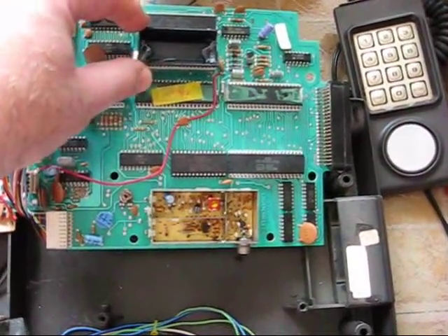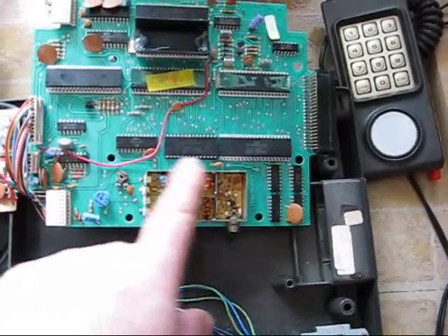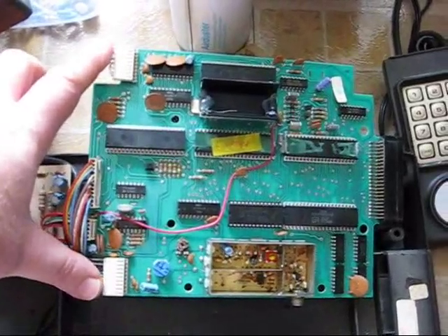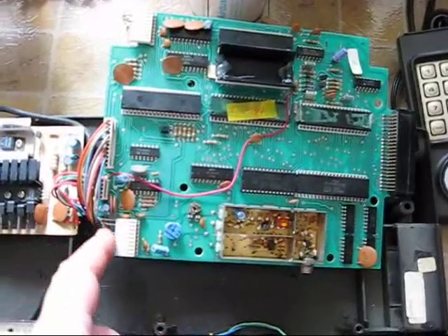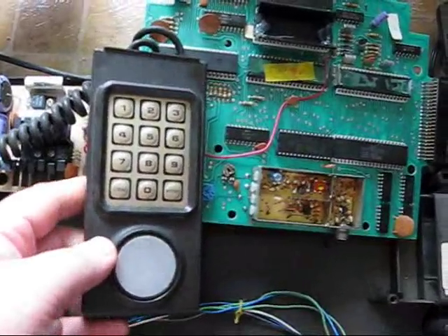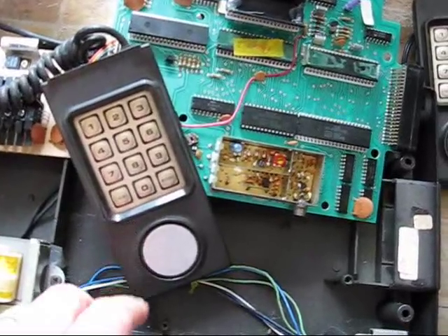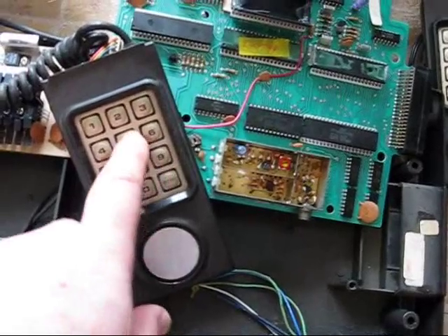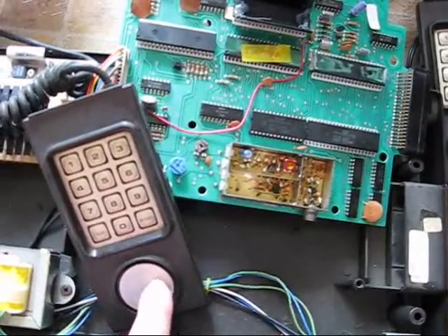These three chips get quite warm but not hot, which is why all they have for a heat sink is a piece of bent metal. The RF module is down here — I took the cover off just to illustrate what it looks like. The controller plugs are over here. One interesting thing about the controller is that it uses nine wires to generate all the button presses, by the use of a matrix — very similar to a computer keyboard — where it uses two or three sources of reference so that it knows what button, side button, or direction on the D-pad has been pressed. Quite clever.